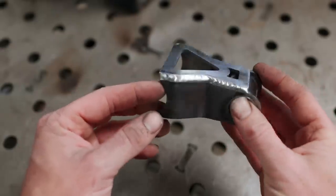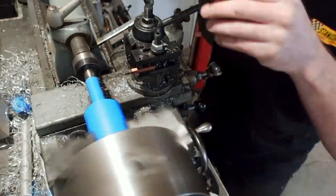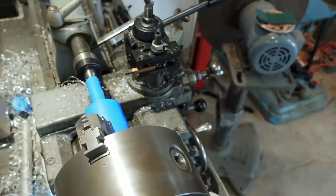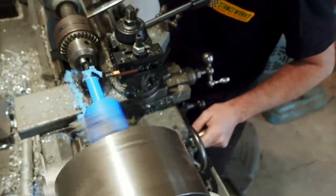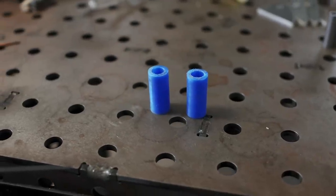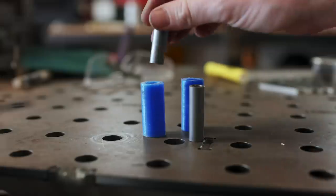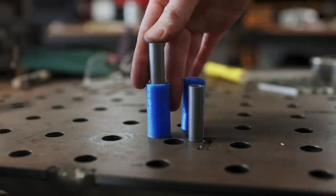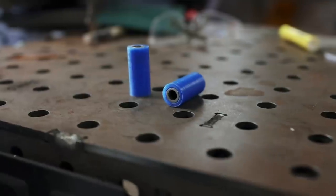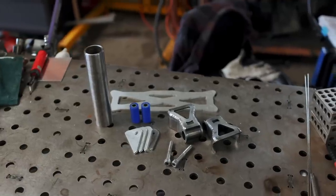Now let's head over to the lathe and start machining our bushings. My bushing material of choice is high-density polyurethane. I used this same material to make bushings for a buddy's control arms on his Isuzu VehiCROSS about a month ago, and found it to be at least somewhat easily machined, so it should do the trick for this job too. As an amateur on the lathe, it did take me some time to get the tolerances right, but ultimately it worked out. I machined the inside to a 10mm inner diameter so that we can insert a steel sleeve through the middle. The purpose of the steel sleeve is so that the bolt passing through won't wear away at the poly bushing over time.